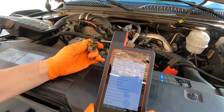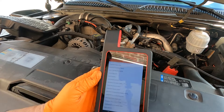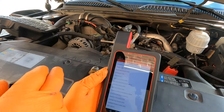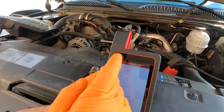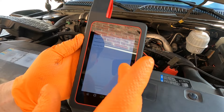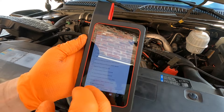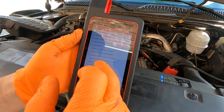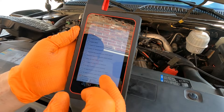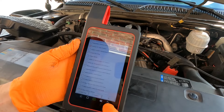These things are really expensive, so you don't want to replace a part that's not actually broken. The way to test it is to get yourself a scan tool that will allow you to actuate different things. On this particular vehicle, we're going to go into powertrain, then into the engine data, turbocharger data, and we want turbocharger vane position control — specifically the desired turbocharger vane position sensor.